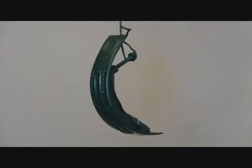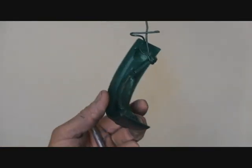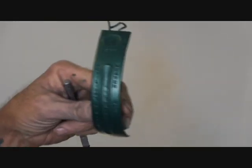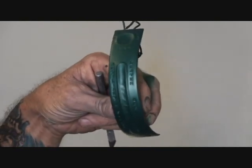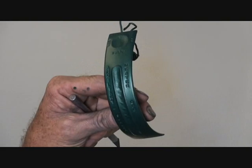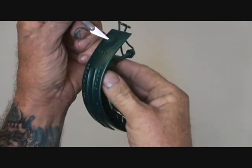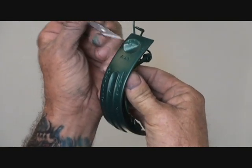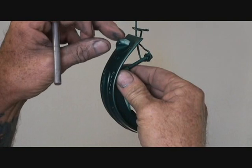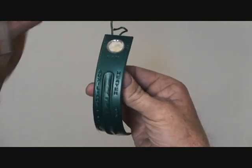So, what you got here is, if you look close, okay? Now let me show you. It's very important when you are working with a piece in a vintage car like this that has chrome plating and paint, and I'm painting this with base coat, clear coat, DBC, PPG paint. As you see, I have taped off the chrome, and now I'm going to peel it off very carefully. We don't have any clear on this yet. This is only the base coat paint.